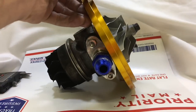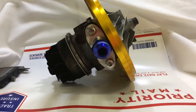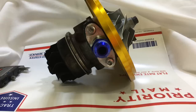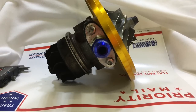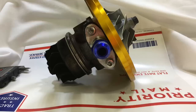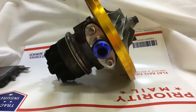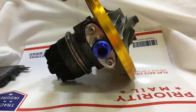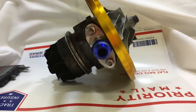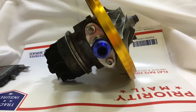This drain here is 9.95mm inside diameter — it's a 10AN. A factory oil drain straight off a car is 16mm inside diameter. That's a 6mm difference in oil flow to your oil pan, and you wonder why your turbo is blowing oil.